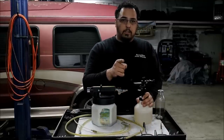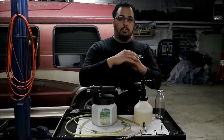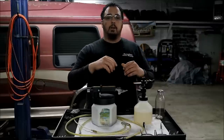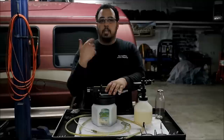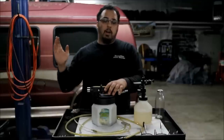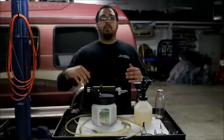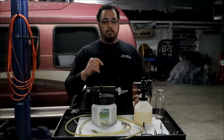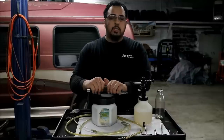Fill up the master cylinder, fill up the reservoir, turn it over, and adjust it to where you want. Once set, it will continuously fill the master cylinder with fluid and never let it go empty. With the pump you suck out fluid from different parts — you can always start from right rear, left rear, right front, left front, or some vehicles want you to do right rear, left front, left rear, right front. That varies by vehicle.